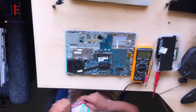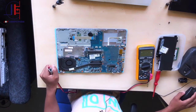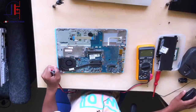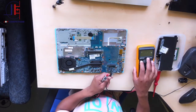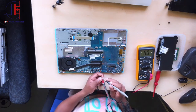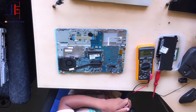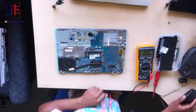Okay guys, here we are. I have the board here. So how do we fix that? Let's do a checklist. Step number one: check your charger. I don't think there's something wrong with this because I was using it, but we can go ahead and check. How to check the charger is simple — one probe on the ground and one probe inside. We do get 19.3 volts. Nothing wrong with the charger.